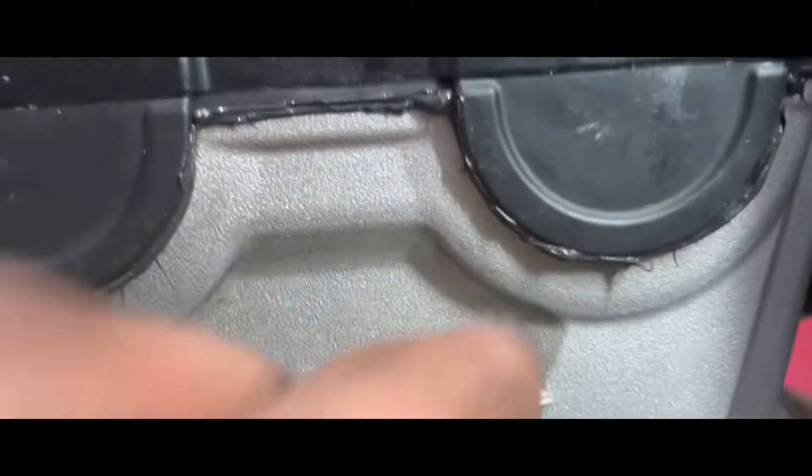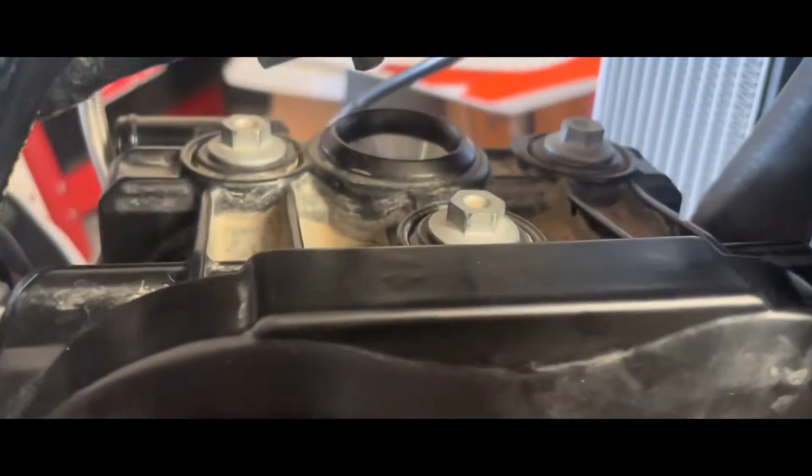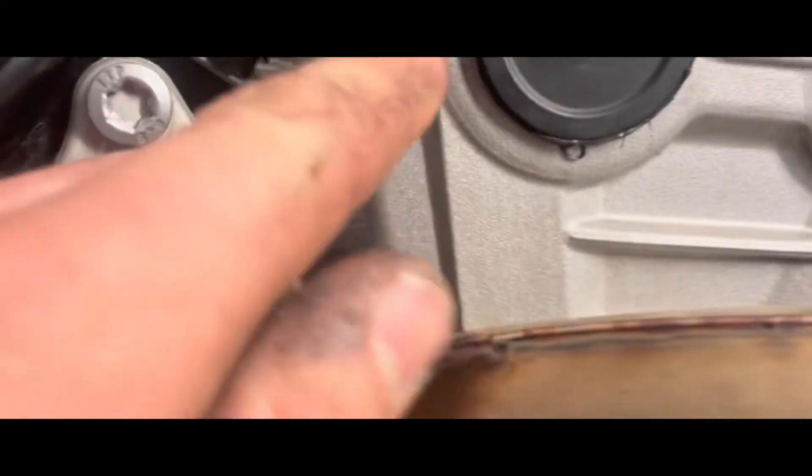We'll smear a little bit in here, then set it up and put the head on. Put a little bit of RTV on — we'll wipe the excess off and it should seal really good. Get all these tightened down. Go in a cross pattern when you do it, get them nice and tight but not too tight — you don't want to strip them. Then just take a little rag and wipe the excess off and you're good to go.